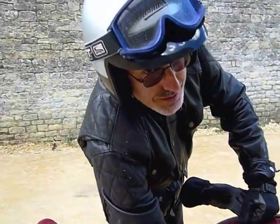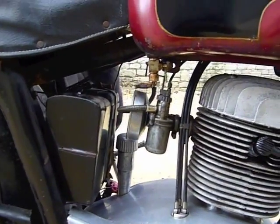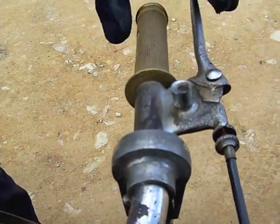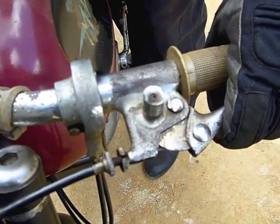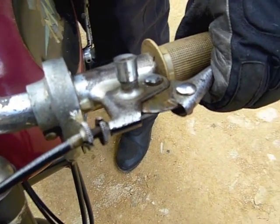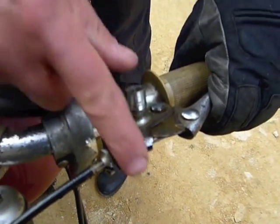Most of it's normal: turn the fuel taps on, choke if it's cold — which it doesn't need to be. Key as per normal, but what's completely different is on the left-hand handlebar we have not a clutch, but a neutral lever. This neutral lever is attached to an infinitely variable control that gives you your gears — low this way and high the other, or minimo and maximo as our Italian cousins call it.